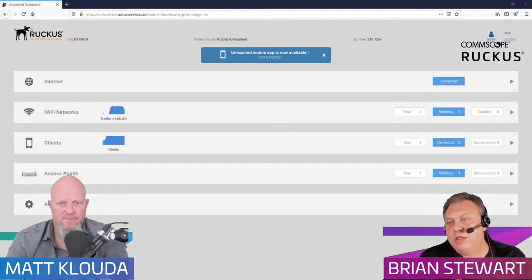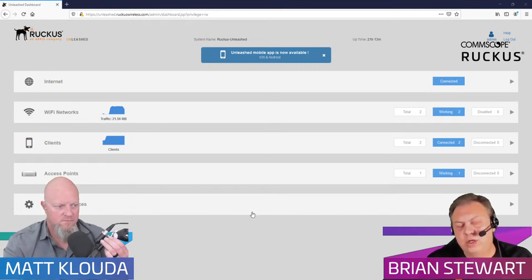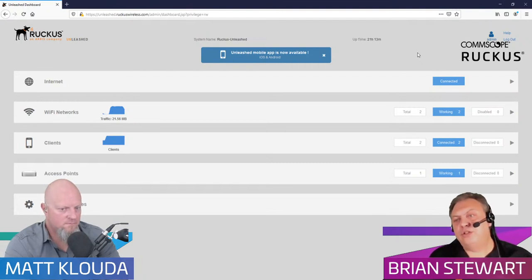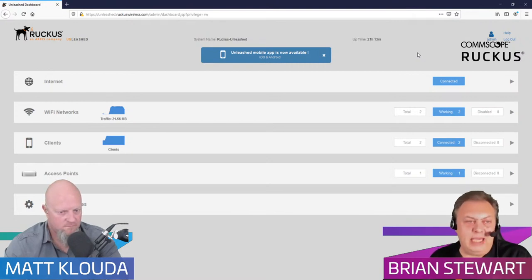So for one of the earlier questions, can you pre-configure this through the app? No, you would not be able to pre-configure it through the app. We do have other solutions that would work that way. Our Ruckus Cloud solution, our SmartZone or ZoneDirector controllers would work that way. But if you're using Unleashed specifically, Unleashed runs directly on the AP itself. So the app does not store any data about configuration of your network. That is all pulled in real time from the access point that is acting as the master for your network. So you can't pull down the Unleashed app and pre-configure your networks. You have to have a Ruckus AP there to use the Unleashed app to do configuration of the networks in the environment.